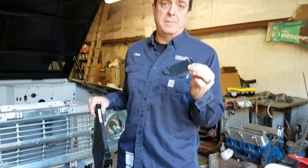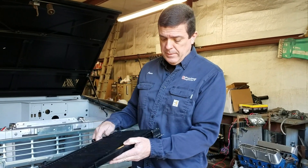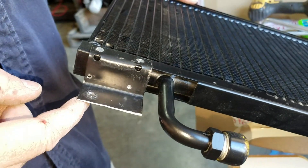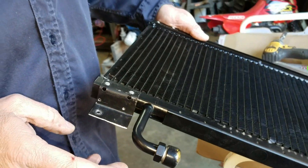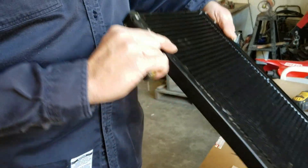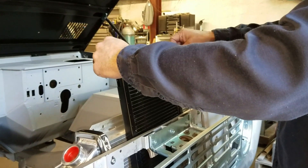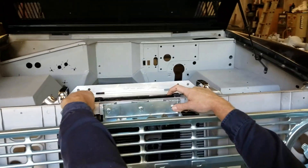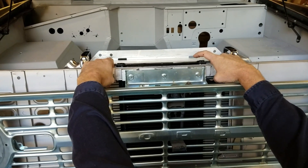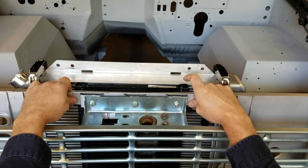This is how I install it. They start you off with a set of flat brackets — that's what they send you. I didn't see any good way to use those with the radiator I'm putting in. So I ended up putting a 90-degree bend on my brackets and I'm going to use rivets to attach it. I'll clean them up and repaint them, but this was to get it to fit right. We put the 90-degree bend on both sides and this is supposed to center the condenser and fall down in between the radiator and the core support. What they want is this condenser centered — basically center of the radiator, center of the grill — and I had to make those brackets work myself.